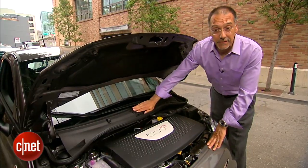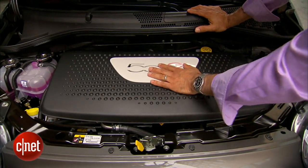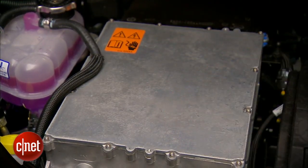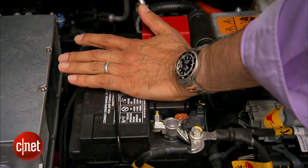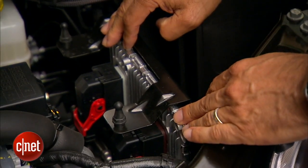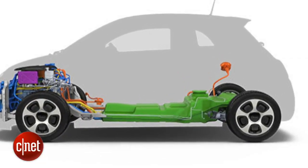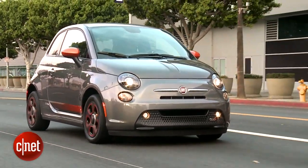Under the E's diminutive hood — about the size of a clipboard — you'll find a special engine cover covering no engine at all, just an electric motor. You actually can't see the motor first; what you see is the inverter, a key part that turns the DC in the battery into the AC the motor wants. There's also a service battery, an electronic control unit, and basically nothing serviceable up here. You do see elaborate cooling reservoirs because the key technology is the battery, which has a thermal management system so that in hot or very cold weather, range stays pretty much spot on.